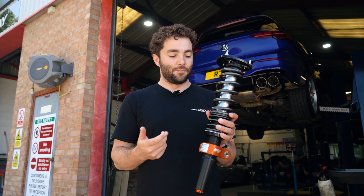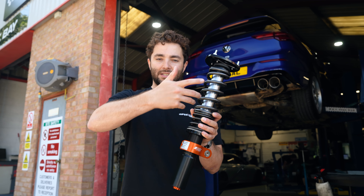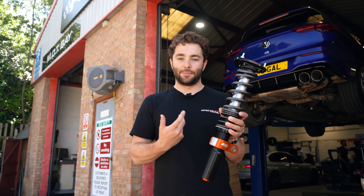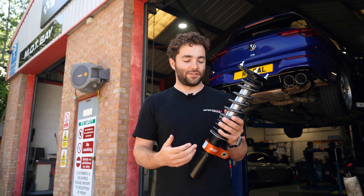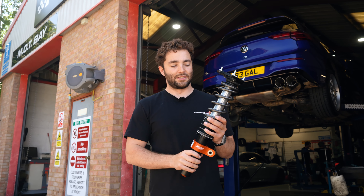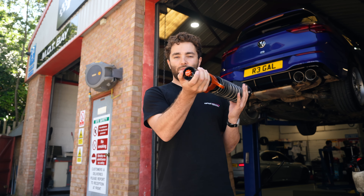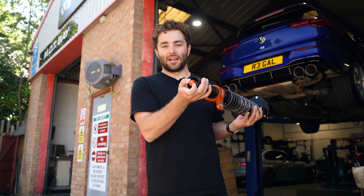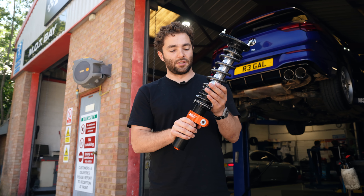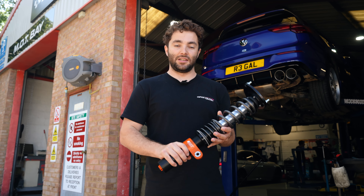Because the cylinder is so wide at the top you can see this is an inverted damper — the cylinder that's usually inside the damper body has been switched upside down. This particular damper has a very wide cylinder, allowing a very wide piston that's bigger than most other inverted kits. On a McPherson car that's really beneficial because it resists the bending load that goes through the damper in corners, reducing deflection and making the car feel more direct. At the bottom you've got the one-way rebound adjustment — about 12 clicks on this damper. The damper is also KTL treated for a nice anti-corrosion black finish.